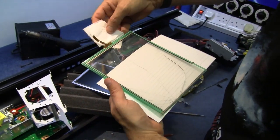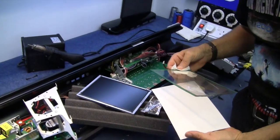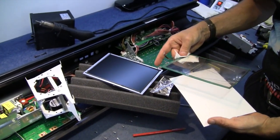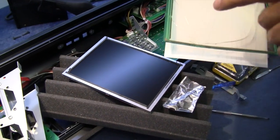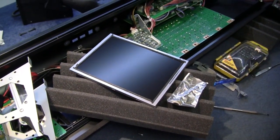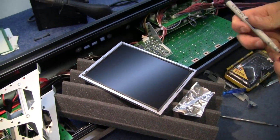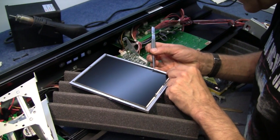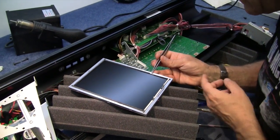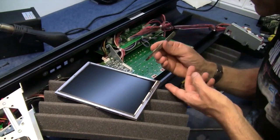Here is a complicated multi-way ribbon that goes to the LCD — I'm just going to put something here to try and heat shield it because it's plastic and I don't want to destroy that. I'm at the far end of the LCD display now, just heating up the last piece of glass to try and loosen the glue a little. So there you have it — there is the broken piece. Now there are shards of glass all over the LCD display, so I'm going to have to get those up as carefully as possible. I don't want to scratch this at all.